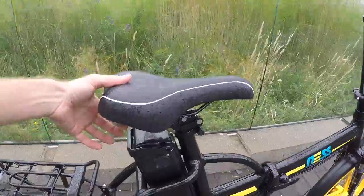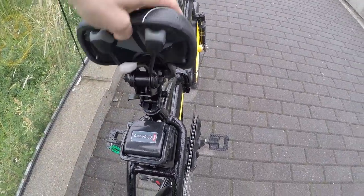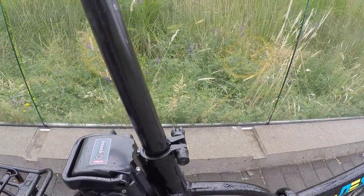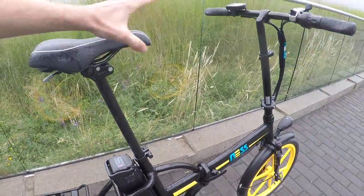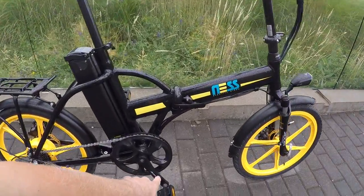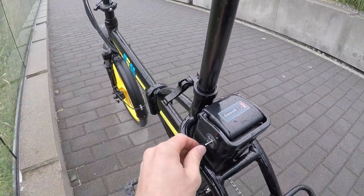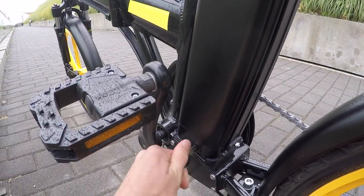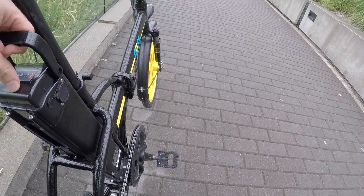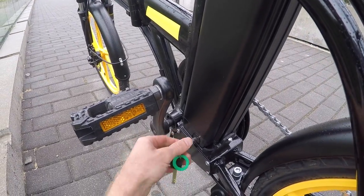The seat has a little lever on the back — you can flip it up to pull the battery off without moving the seat. This is a 28.6 millimeter seat post diameter. If you want an extra long seat post for extra tall riders, there's a minimum insertion height marked on the post, and with standard 170 millimeter crank arms this could work. The charging port allows the battery to be charged on or off the bike. To remove the battery, you unlock it and pull the key out first — otherwise the key bangs the seat stays. Make sure you lock it back or it can vibrate while riding.